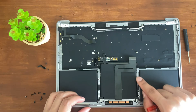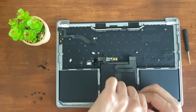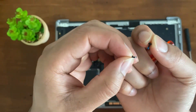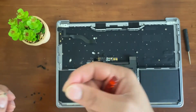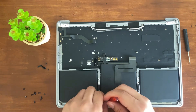Now that you've finished all these screws, I just want to let you know there are some more screws down here — there are two of them right here and here. Don't worry about the ones right next to the copper; that's actually for the trackpad itself, which I'm assuming gives you the haptic feedback. You're just going to take out these two on the side. They are different from your regular screws — as you can see, one has a white stripe and the other has a blue one, so you'll be able to tell them apart easily.